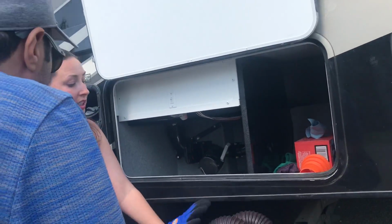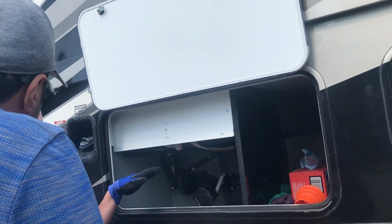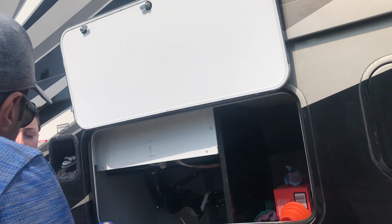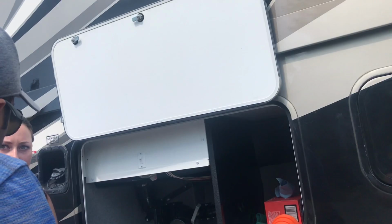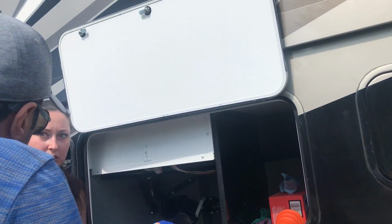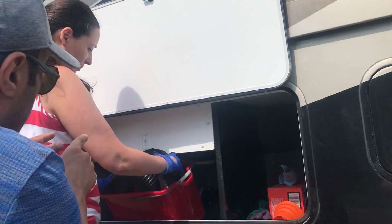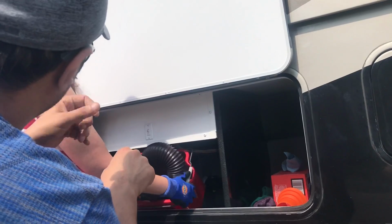Yeah, just remember afterwards, I fill this up with water. I go into the toilet and I pour water down because the caplets that you put down there activate by water. So if there's no water in there, then you're gonna start to have smell from the bacteria. Does that make sense? You want a little bit of water, and you want to make sure that you put those chemicals in your tanks. You will notice if you don't.